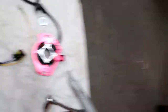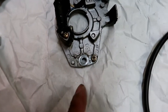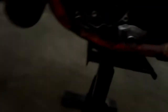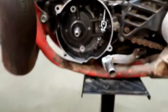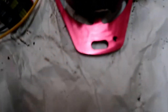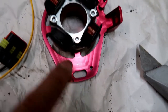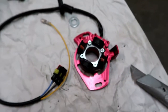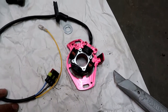So we got the new stuff here. What I had to do was mark the timing — you can see on this piece there's a little dash right there where my fingernail is, and that lines up with this guy here for the timing. The instructions tell you to basically mark the new one — you can see my little black mark right there. There's a little bit of adjustment in these holes. Once you get your mark set, there are other ways to time it but they're way more involved and I'm not going to get into it in this video because I'm not an expert at that.